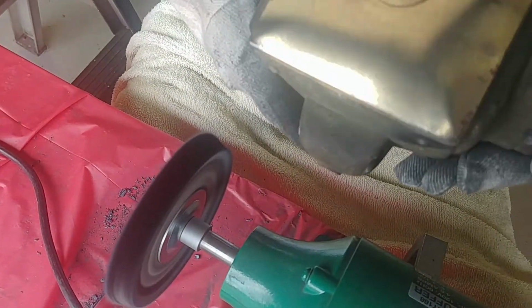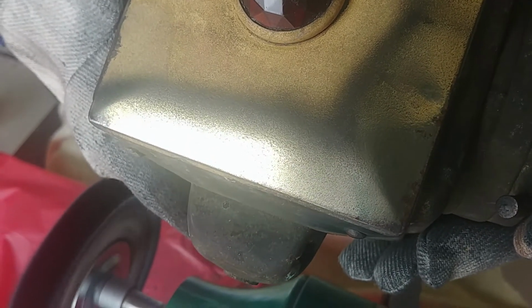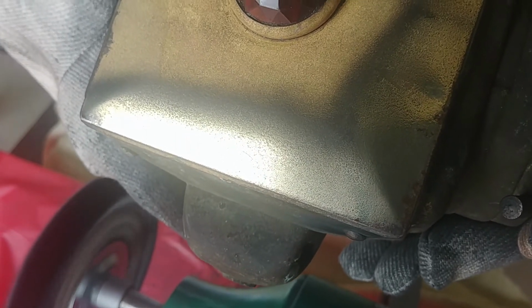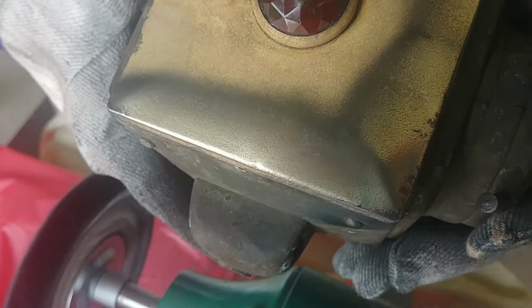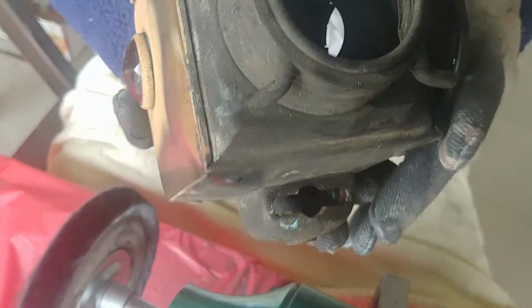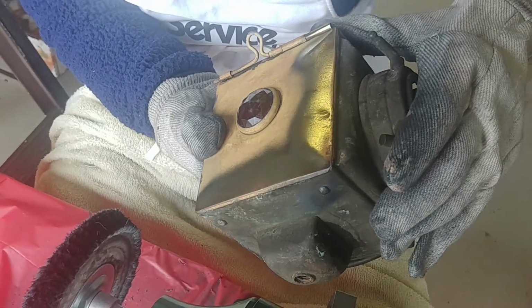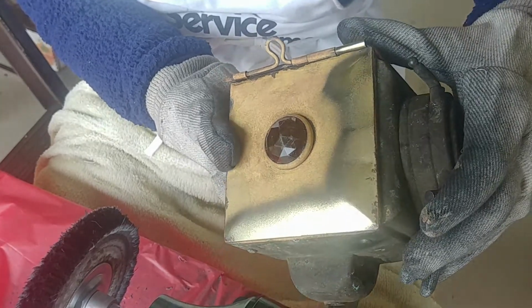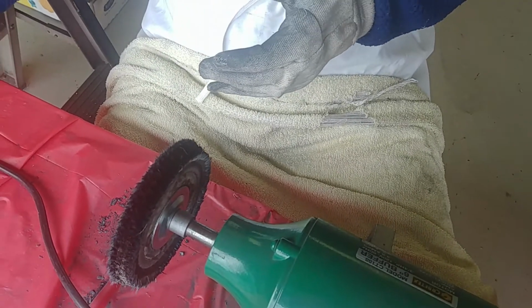And I'm not sure if that's years of oxidation or we just shouldn't have left the material on as long as we did. So what we can do, just to verify that, is to apply some to possibly this side, leave it on for 7 or 8 hours, take it off and see if we have the same level of pitting there, because for sure if it's going to pit, that's not a result you want. So I'm just going to put that little guy aside.